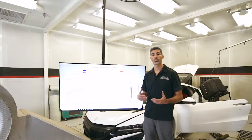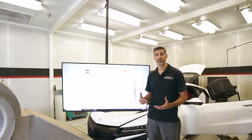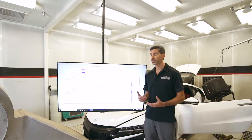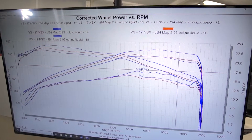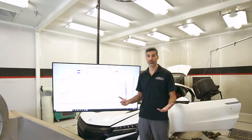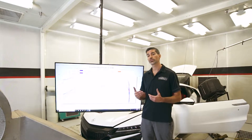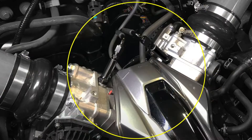That's pretty significant, and when you increase performance targets that degradation increases even more. This graph demonstrates a nearly 50 horsepower loss after only three repeated runs, and that's simply from the engine and the intercoolers becoming overheated. Let's look at what that looks like with liquid injection added.